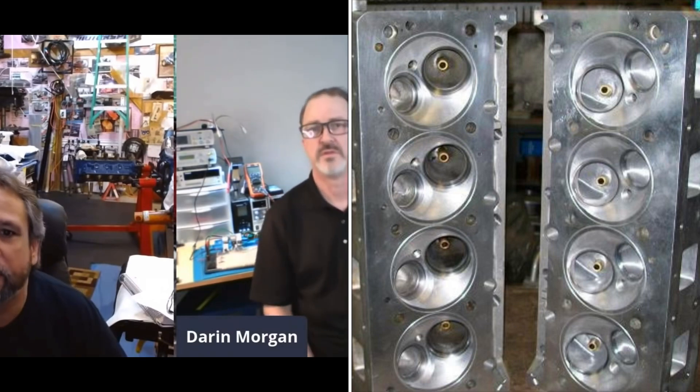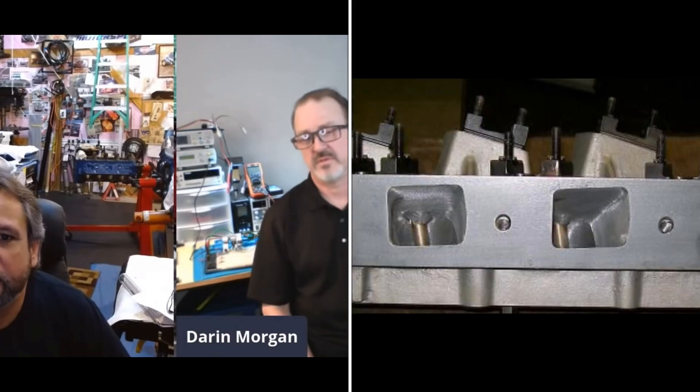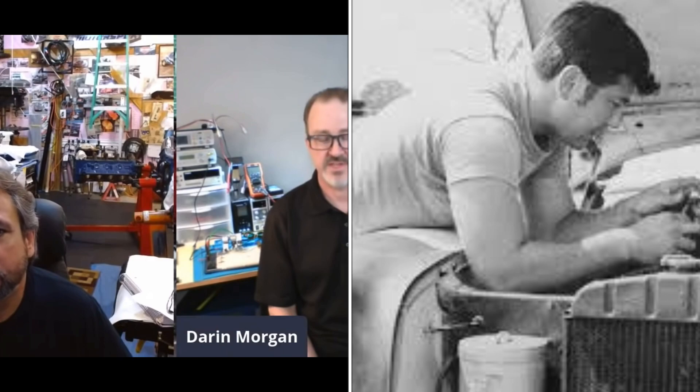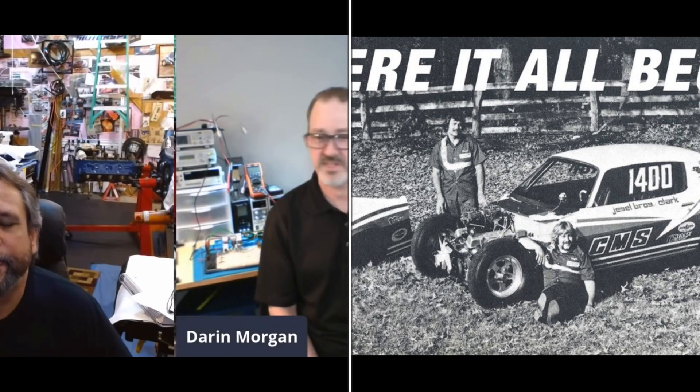What did you think of the AR head compared to the stock Ford Boss 429? It had a lot more potential. Rusty was telling me they had a lot of problems breaking exhaust rocker arms. Yeah, we didn't have very good valve train components for what we were doing back then. The only reason we have the engine speed you see today — the 10,500, 11,000 RPM stuff — is because of Jessel. If it weren't for Jessel, we'd still be at 9,000 RPM. And T&D — T&D stuff winds up pretty good too. With bigger core cams, like a 70-millimeter cam — you're talking about three inches in diameter — 700 lobes, not a problem.